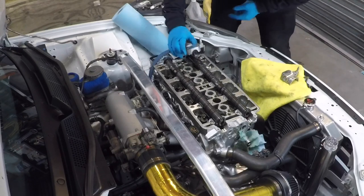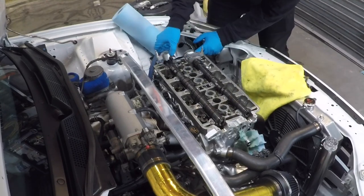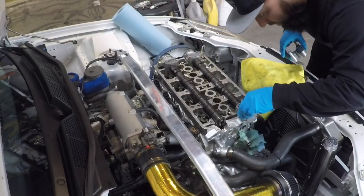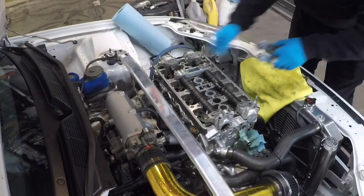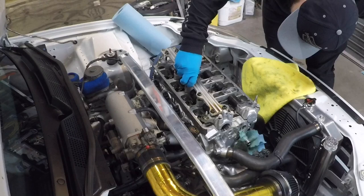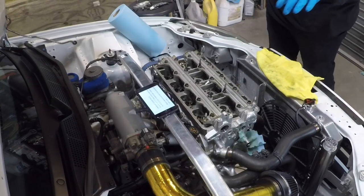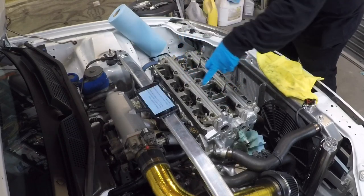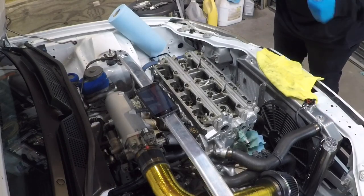The front one first. Have my exhaust side. And my intake side. Covers, and I'm going to start torquing these down. These bolts are all 20 pounds, and the 10 millimeters are just over 7 pounds, so I'll probably end up doing 10 pounds on those as well. So let me start with this sequence.